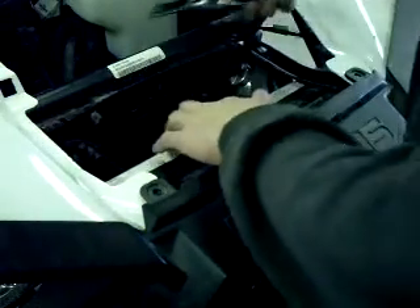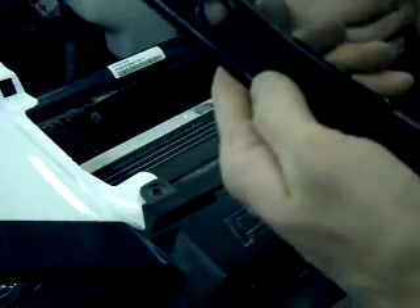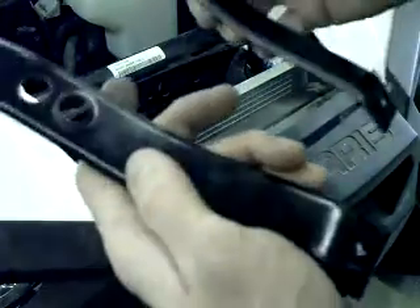As far as any modifications that you need to do, let's start with these upper mounting bars. This is your stock mounting hole where the rubber grommets come through. What you need to do is go back seven-eighths of an inch and do your pilot hole right in line with the other hole. Get your pilot hole started — like a three-sixteenths — and then you're going to want to put a nine-sixteenths hole in here. Clean it up nice so there are no burrs chewing up your rubber after you're done. I went through and drilled the holes, repainted them, made them look new again.